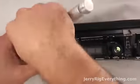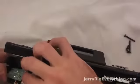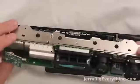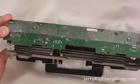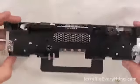And there's one more screw that holds on the little circuit board on the front they have to remove, and then that exposes the little white ribbon that you can unclip from the main board. And that separates the motherboard and heatsink from the actual device itself. This is just the bottom plastic.